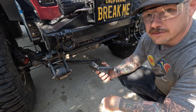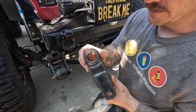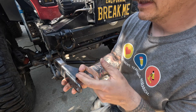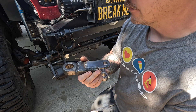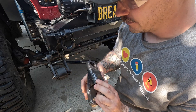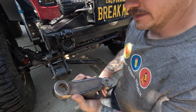This is what the pitman arm looks like now. It's a drop pitman arm with the bend in it, and I cut out a steel plate for both sides — nothing fancy, this is all 3/16 steel and just MIG welded on there. This thing probably weighs twice as much as it used to, which is part of the goal — I wanted this to be stronger than the old pitman arm. This one's a little shorter so I'm hoping the steering will be a little more in line with the rate at which the ram wants to push and pull. On the top it's two layers of 3/16, so three-eighths total — I think this thing's going to be beefy enough.